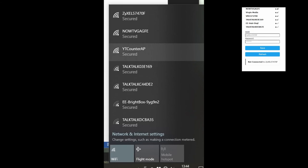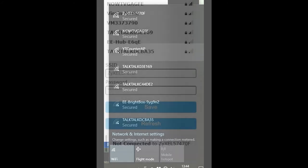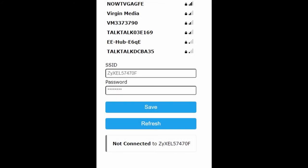If you do this on an Android smartphone it will actually open the web page automatically, but I did this on a Windows PC. When the web page opens, click on 'configure Wi-Fi' and you'll be taken to the next screen. Simply click on your wireless network in the list and enter your network password, also known as a passphrase or passkey depending on your router. Note that if it was previously connected to a network, the previous network will show below; if it's a new device there will be nothing listed there.